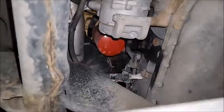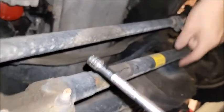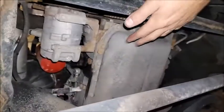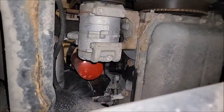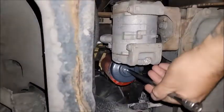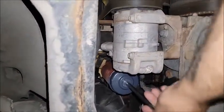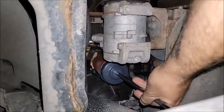Unlike the newer 6.7, this oil filter is accessible through the bottom. Just to give you some reference — just under the front of the truck, there's the front axle, there's the base pan, AC compressor, and there's our oil filter. All you do is take an extension with our filter cup that we just mentioned, you can get right on that and it fits perfectly. Just spin off your oil filter, spin on your new one — very little mess.